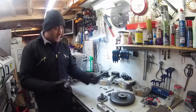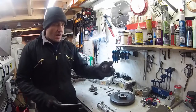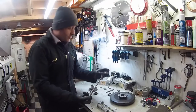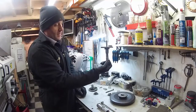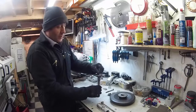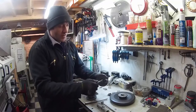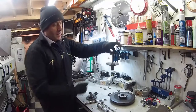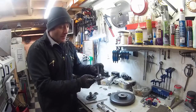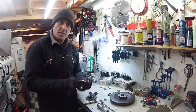With the flywheel in place, we'll use this tool here. The crank half with no thread we'll put in first. We'll assemble this tool up from the bottom, lay the crankcase on its side, and drop the left hand crank onto the pin with the rollers in place, then lower it down from underneath - because on this side there's nothing to get hold of to lower it by hand. We'll push it into the flywheel just to get it to hold on the taper. Then the other half of the crank, which has the thread in, we can screw in the crank bolt a couple of turns, put the bearings around there, put the gland in the crankcase first, lower that down, wiggle it in because the bearings are a good fit in the cups. Then take that bolt out and assemble it from the other way correctly, tighten it up, and knock the cranks up a couple of times on each side.